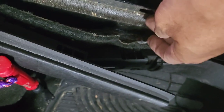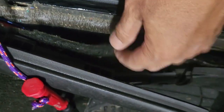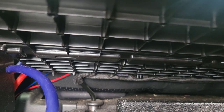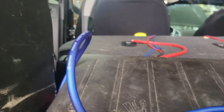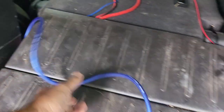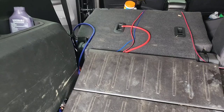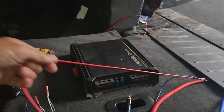Make sure you sneak the wire all the way in — if you put the remote in there and accidentally hit it, you could burn something up. I couldn't get this all the way out because I think that's a gas line and I'm not going to touch it. So I'm going to sand this area really well, put the ground there, and use a longer wire that I'll cut later. This wire I ran from the front is for the subwoofer output.